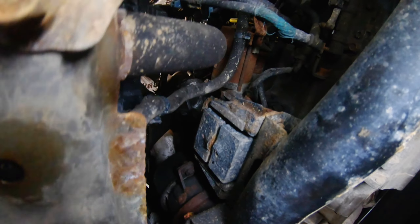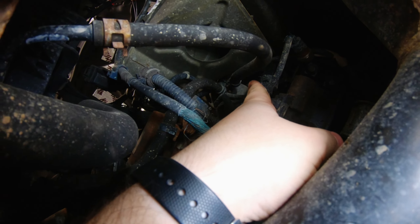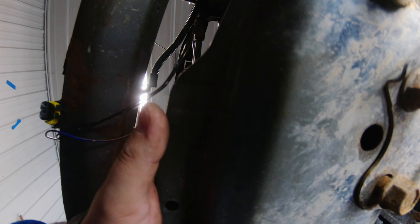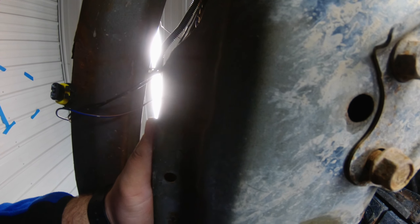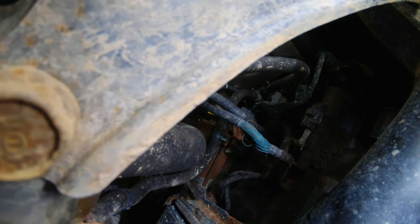So we're under the car now. This is the hose that we need to remove — it comes from the tranny down here. We're going to remove this, and one hose is going to go to our cooler right over here. The second hose from the cooler is coming back into the transmission. So from the radiator we're going to the trans cooler, and from the trans cooler we're going back to the transmission. That's pretty much all there is to it — it's just hard to get to the hoses.